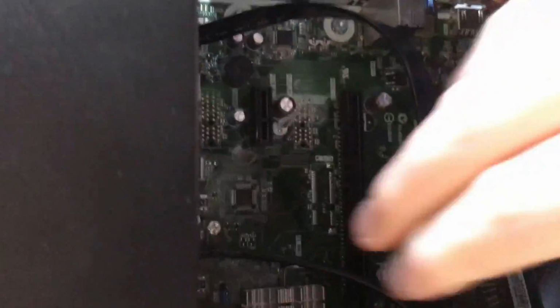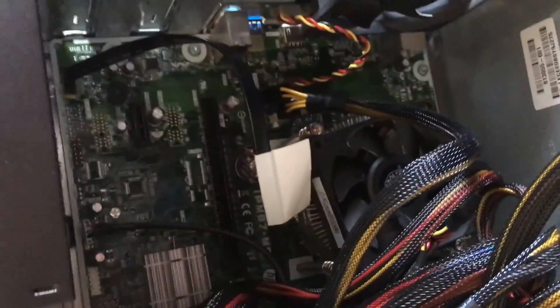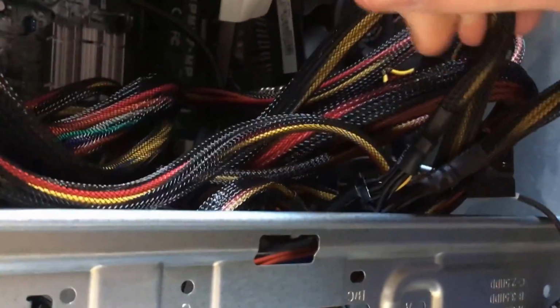Next thing you're gonna make sure you need to have, or basically you can't build your system at all: a case, a big case. There's a bunch of different types of cases: ATX, micro ATX, mini ATX, eATX. Make sure your motherboard, your case and your power supply all are the same. Like, all are ATX, micro ATX, or eATX, extended ATX, if you care about the full name of them. So just make sure all of your parts are compatible.